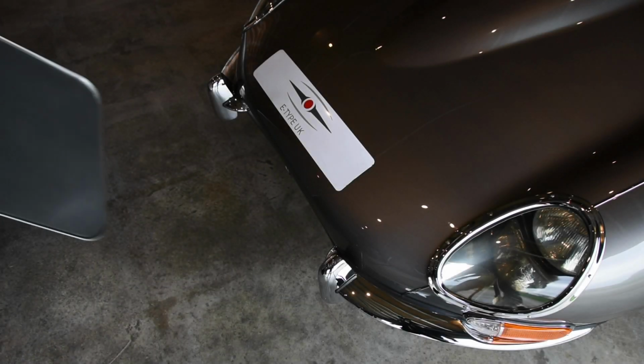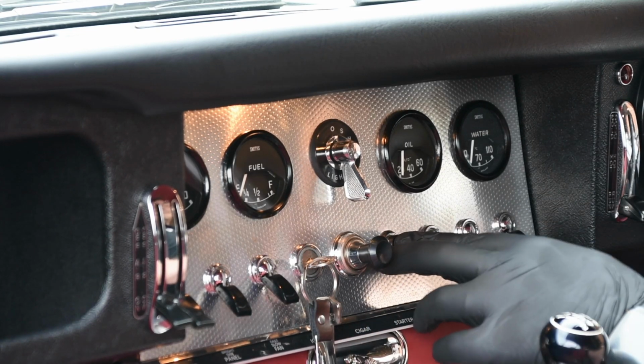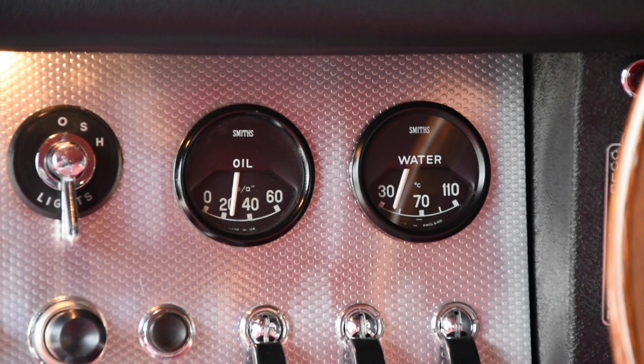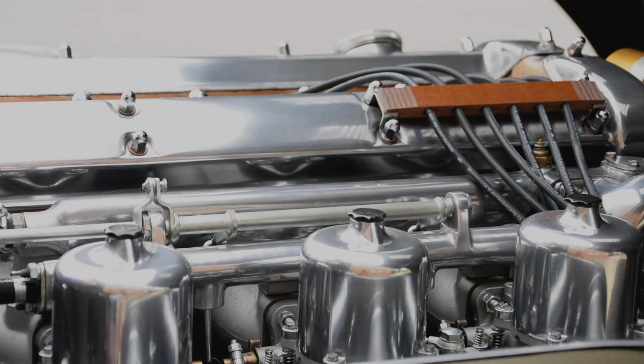Throughout the duration of your car's storage, you should be keeping an eye on the fluids. A drip tray is a useful tool in monitoring this. If possible, it can be beneficial to start your car up regularly, allowing the engine to get to temperature, fluids to move around the system, as well as properly charging your battery. Remember to only perform startups in well-ventilated areas.